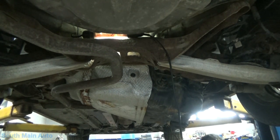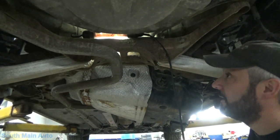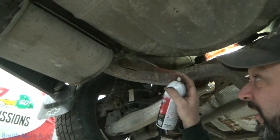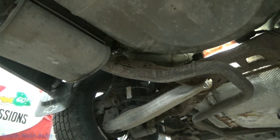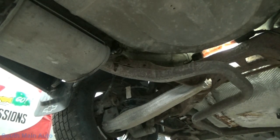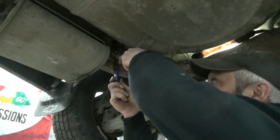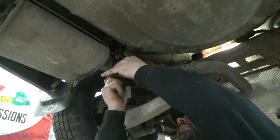I don't want to rip and pry. Well, here's what it is. Let's get the exhaust unhooked. So we'll get the rubber hangers there. Can you see that? Probably not. And then there's one on the back of the muffler. I douse them down with a little silicone spray. But if you want to know the truth, what works better is brake cleaner. You hit them babies with brake cleaner, that makes that rubber super slippery, and it'll come right off.